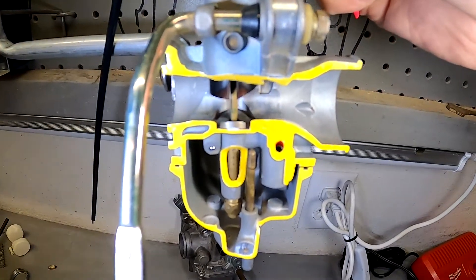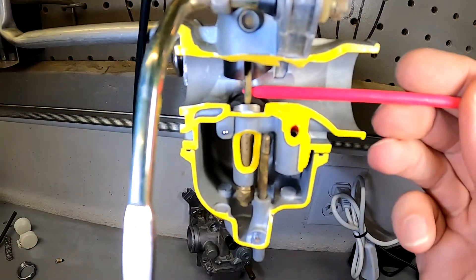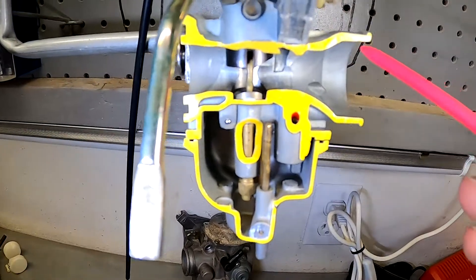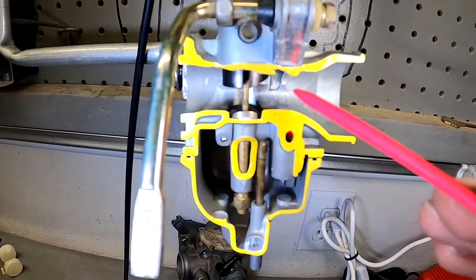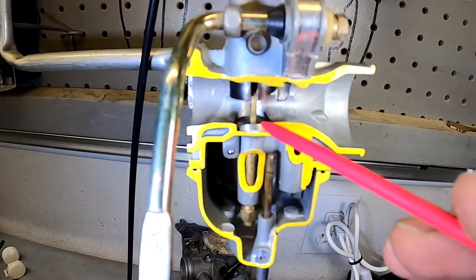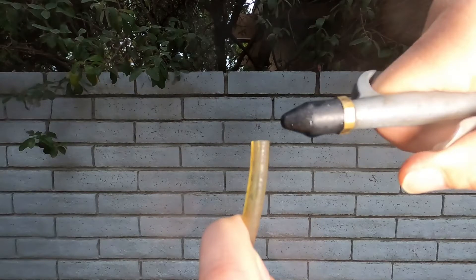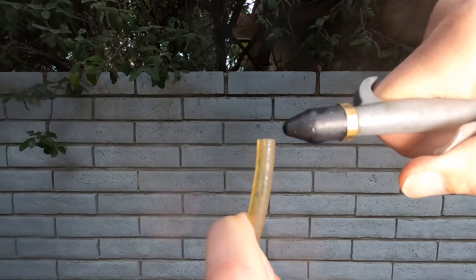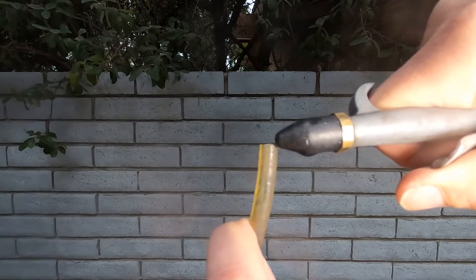When you give it a little bit of throttle, the slide goes up connected to the throttle and air comes in through the venturi. See how it necks down in this area right here? The air speed increases and the air pressure decreases, and that helps create a pulling of fuel right out from around this needle. To simulate how fuel is pulled up through the jet orifice, we can take an air compressor with a hose and some blue fluid to show how air rushing past perpendicular pulls the fuel up.